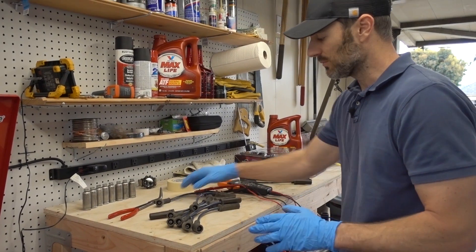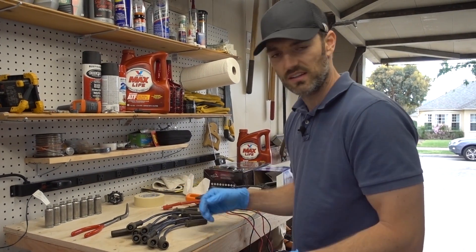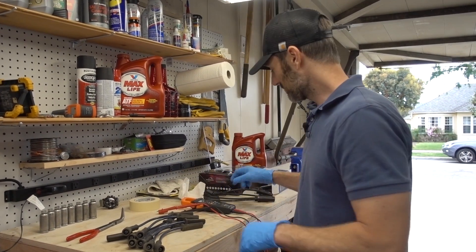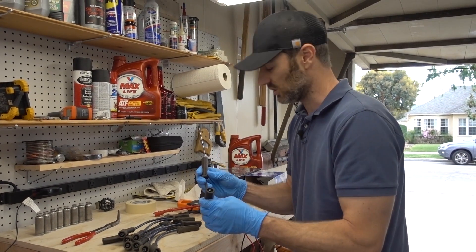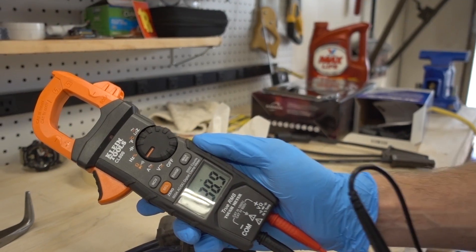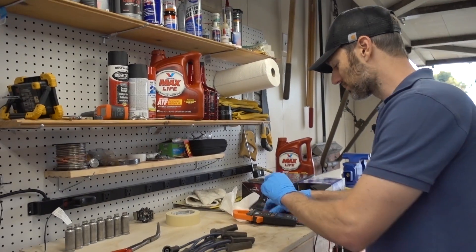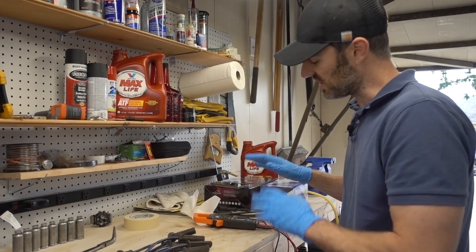That is a recurring theme with all of these wires. I tested six of the eight of them, and every one of them is about 150 to 200 ohms. That is very low, because when I take these brand new ACDelco Professional wires and test these, the ohm rating is right about 438 — we'll call it 440 — and that is pretty much a recurring theme for all of them. I tested all eight of these ones and all of them were the same. The lowest one was 408.